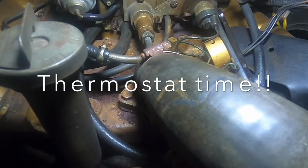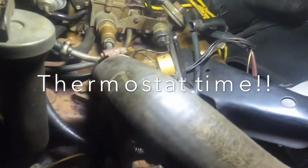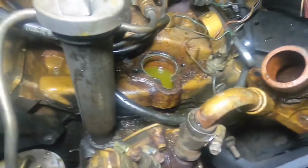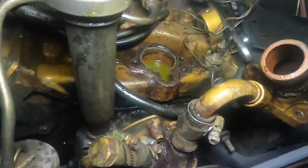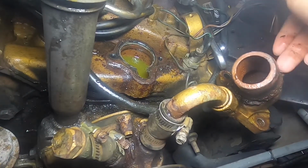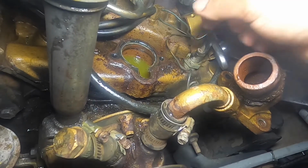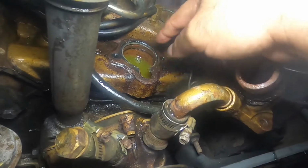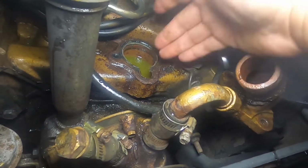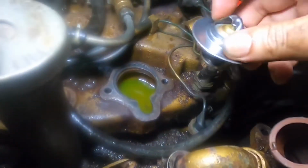This is the radiator hose, so of course you have to take that out. Catch the extra coolant that comes out. All right, see, I got the thermostat housing off. Now you're just going to clean it up, clean off the housing. You can see all this corrosion and stuff. Just hit it with some light grit sandpaper. Make sure you don't get dirt in there, but other than that, just clean it up. Put the gasket back, thermostat. Like I said, easy job. It goes cleaned off.